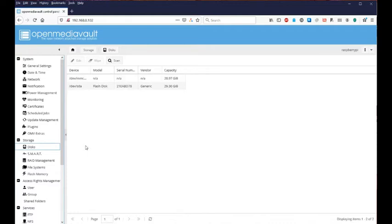When you go down to the disks here and select your disk to use, this will be our flash disk, of course. I found that when I used my existing flash disk, it never worked until I erased it and started over. I think that has to do with the privileges, that the privileges somehow didn't transfer over. Ideally, they should not have designed it that way so that it's that quirky, but this was, of course, only an experimental disk, so I simply reformatted it.